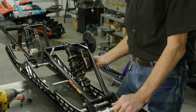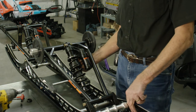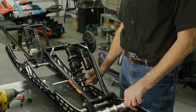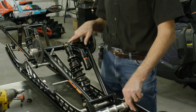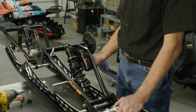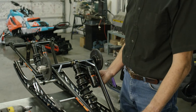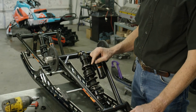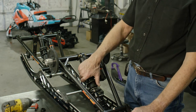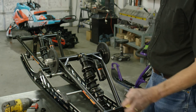Then you have the QS3, and I recommend everybody start in number one — the default spring setting — and ride it. You'll find number one is going to be pretty plush, pretty soft, and will bottom out easily on medium bumps. That's okay — you're using all the suspension. If you want to take away that bottom out, switch to number two first, front and rear. You'll notice quite a difference — it takes all the medium bump bottom out. This is typically where you'll ride in the backcountry most of the time. Number three is if you want to rail on stuff hard or do some jumping — it'll be quite a bit firmer. If you're still bottoming out on bigger stuff, you can do a little more preload. We don't recommend going shorter than an inch and a half on the small spring. Each two turns is about a sixteenth of an inch, so try two turns at a time when adjusting preload. The K-Mod suspension is very susceptible to tuning and very tunable.